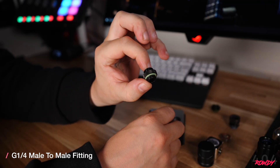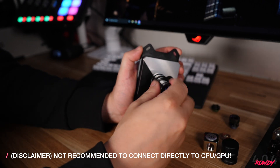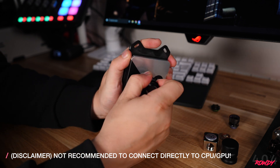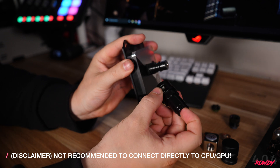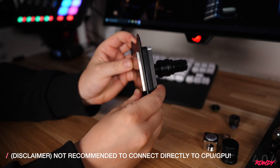Other miscellaneous fittings that might be useful include this — a G1/4 male-to-male fitting. This would be useful in a scenario where, if you're using a quick disconnect which typically comes with only male and female fittings, and you want to mount it directly to a CPU block, you'd use the male-to-male adapter and simply screw your quick disconnect directly to the block. This cleans things up without needing tubing or extra fittings in between. These won't be common for many other applications, but definitely one to bear in mind if using quick disconnects — and double-check that your disconnects are female on the G1/4 thread end.